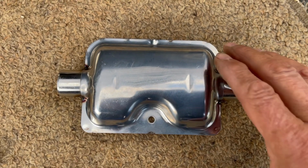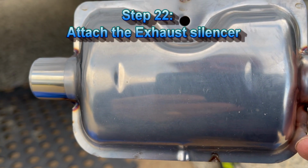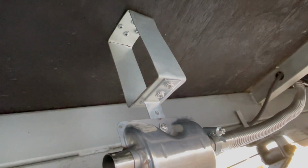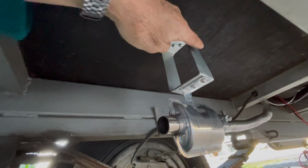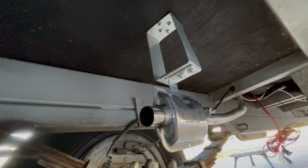Yeah, this is a muffler. But I notice there's a little pee hole here, so it has to be mounted horizontally, otherwise you'll have condensation. That's it. The exhaust pipe is fixed up. Okay, I check it. It's horizontal. We got the pee hole here, and it's attached on the bottom bracket, attached by 4 screws, unbreakable and no vibration.